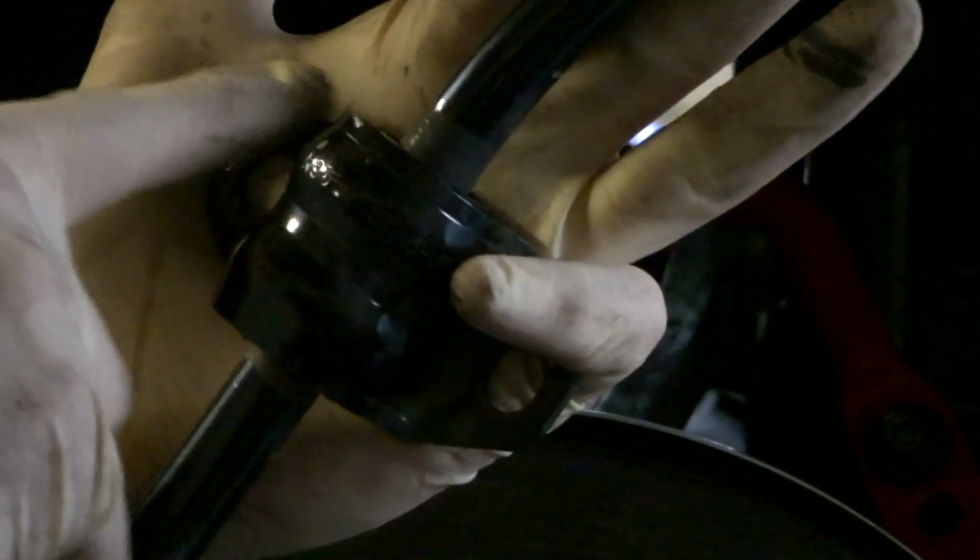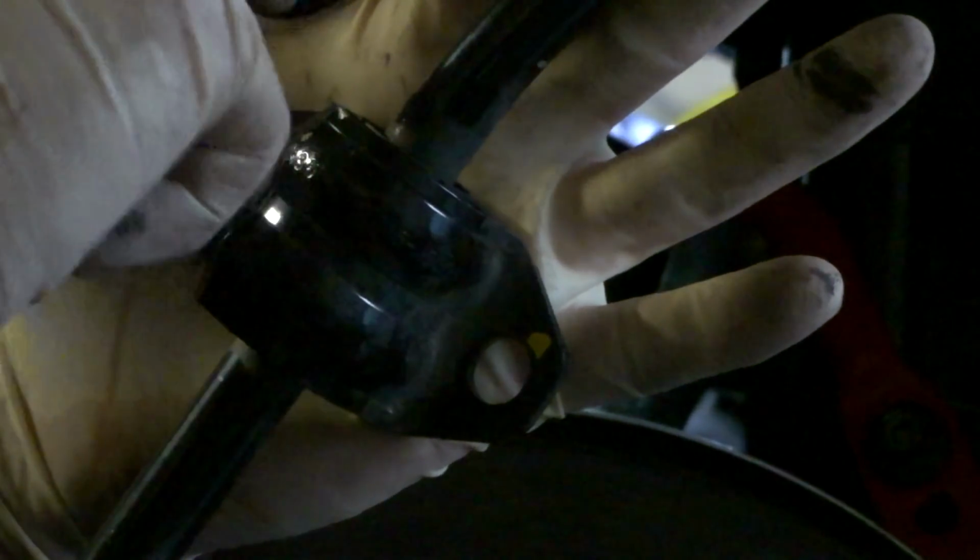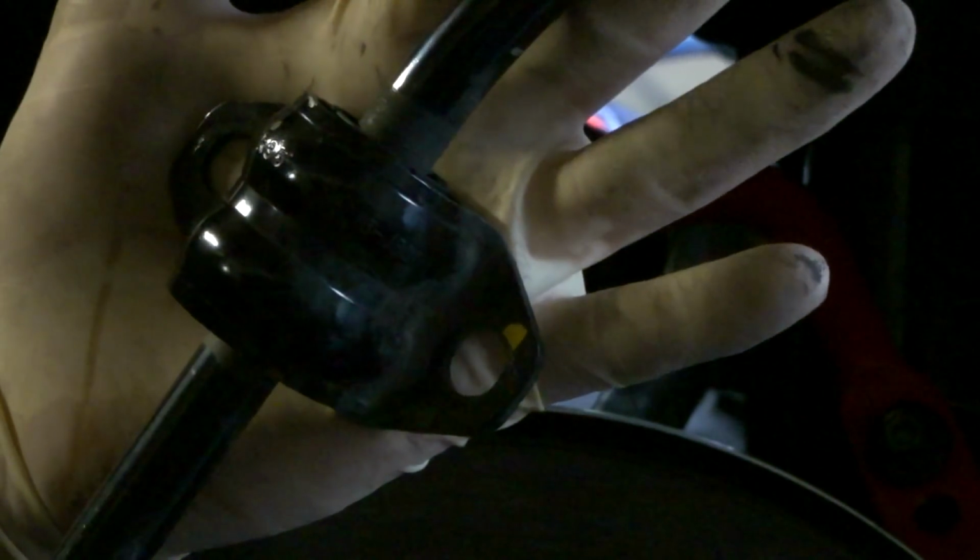This angled bracket is in the bracket with the risers on it. If you saw when we were showing you, the bracket is a reinforced type billet. It's not flat. The factory sway bar was in fact two flat pads. It didn't have any raised billet area in between them. The new one has raised billet, so trying to get in from the sides is going to pose a problem. We are going to have to figure out how to get in from the top.